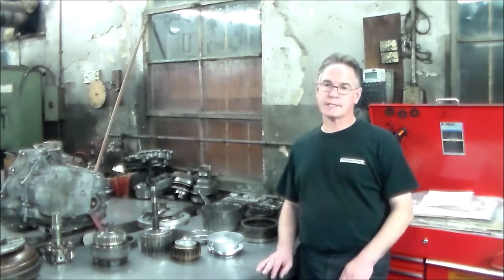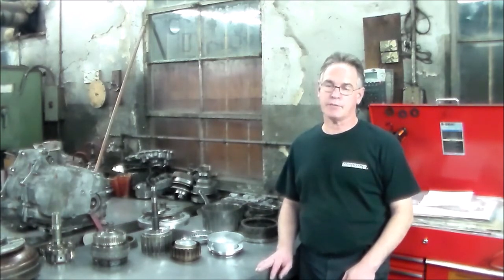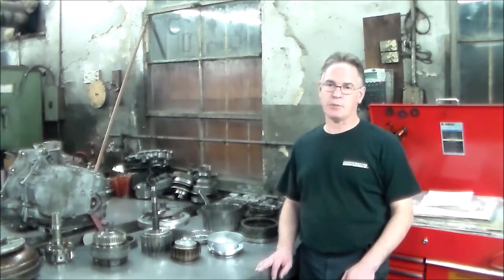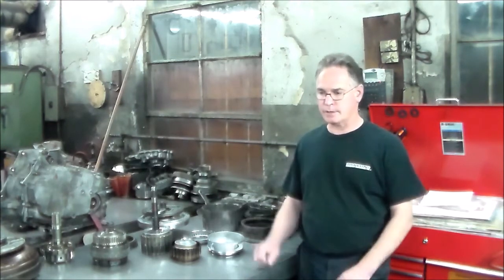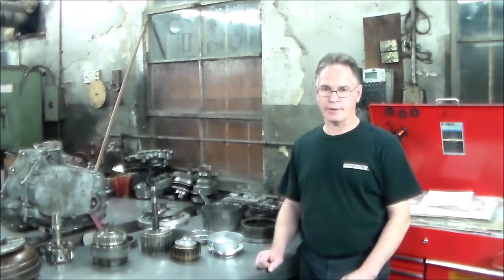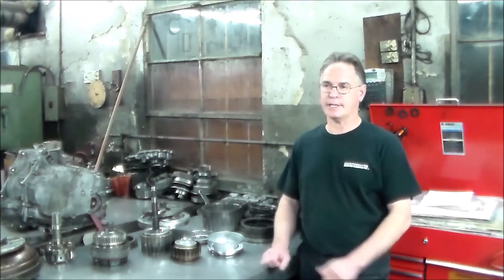The problem with this was it really didn't move that great. It was towed in, and when we got the transmission out, we had a problem getting the converter out. We had to take a couple of screwdrivers and pry it past the front seal because the pump bushing is welded onto the converter neck. Now this is the second time that I've seen this.